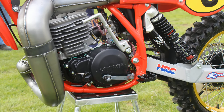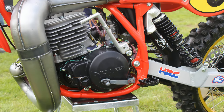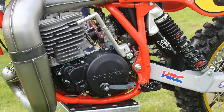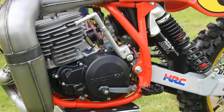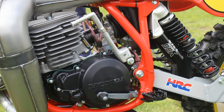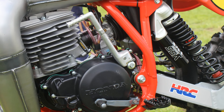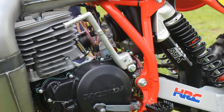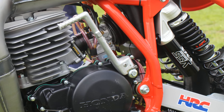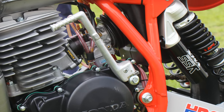Here on the motor's transmission side it was a five-speed gearbox with the usual wet oil-cooled multi-plate clutch. But as I said, the kickstart is on the left-hand side and with this being quite a tall bike, it wasn't that easy to start if you were a bit short in the leg department — so maybe a box for your standing leg was probably quite a good idea. But remember to angle your kicking foot to the side just to stop it fouling on that foot peg.